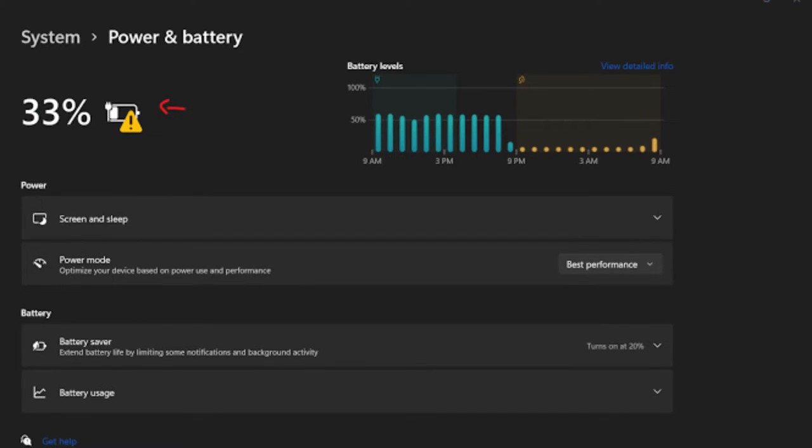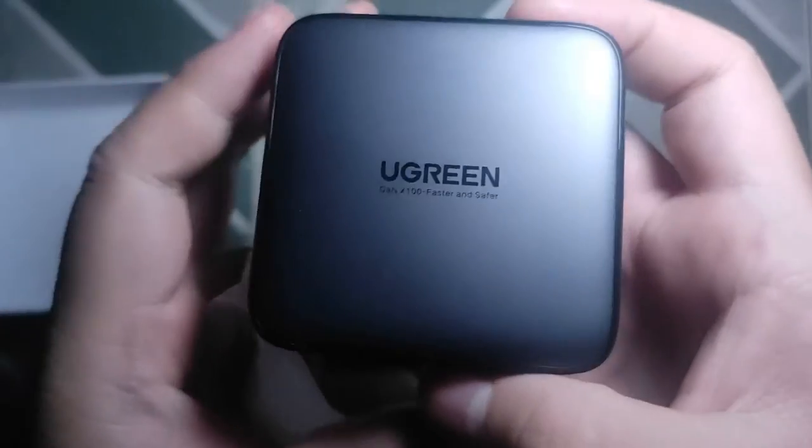To answer your question: yes, you can buy a 65-watt charger if you want. To be honest, I bought a 65-watt Xiaomi GAN charger 2 at first, but when I used it on my laptop, it showed an exclamation point on the battery icon with a warning that the wattage of the power source was not enough and could lead to decreased performance and charging efficiency. So I bought this 100-watt charger instead, hoping it would charge faster. But ASUS says it can handle up to a 120-watt charger — yes, it can charge faster with that adapter, but the consequence is bringing a much bulkier brick.